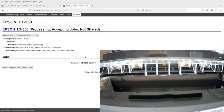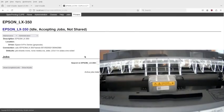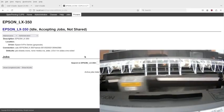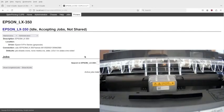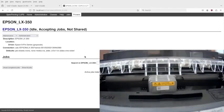So, we set it up to be the IBM Pro printer format, but we just set the driver to be the EPSON printer. So I kind of expected that to not work. So we'll try that again. There we go. Come on. It's gonna keep, okay. Well, we canceled the job in CUPS, so let's turn off the printer and turn it back on, and see if that clears out the print memory.